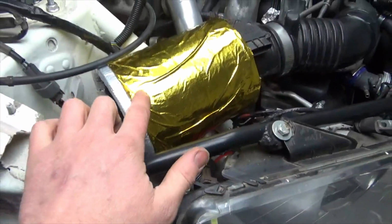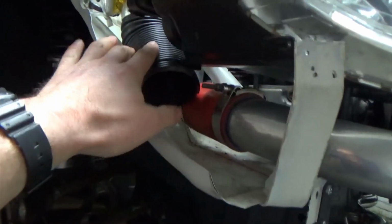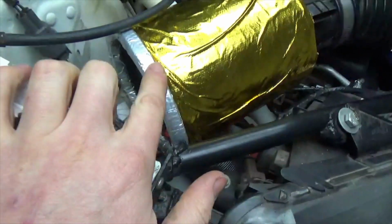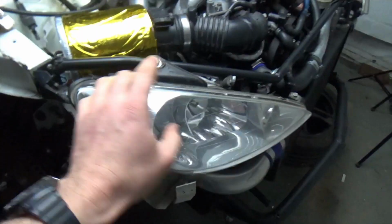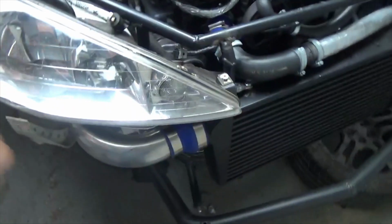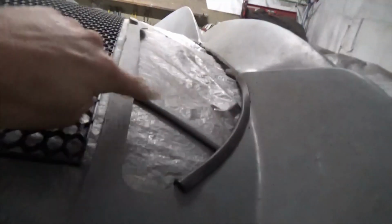The issue I'm suffering with the air intake is space for one, but most importantly, there's very limited space to get cold air in. I need to have the filter enclosed, mainly because it sits directly under this vent in the bonnet. So without it boxed in, it's going to get wet. I need to get the front bumper back on to see where the ducts need to come out. And I have the pre-drilled hole for the ram air duct. I also have a honeycomb grill that I can try on the front bumper.